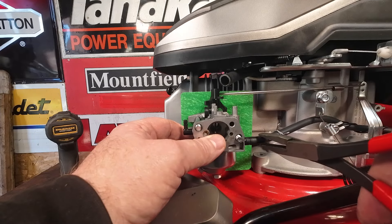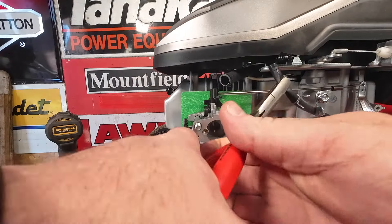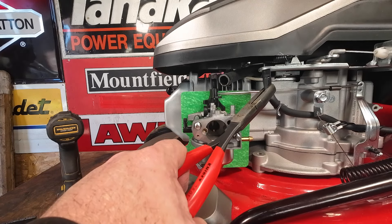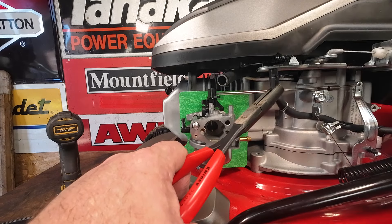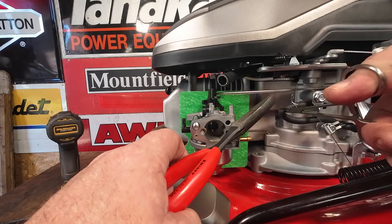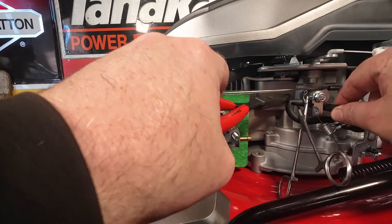I've got a pair of short nose stubby pliers. Once that clip's been removed, get hold of your fuel hose and give it a bit of a twist just to break the seal. You'll see it's starting to lick a bit of fuel. Hold it up in the air — I don't want to get petrol all over this lovely machine. Let me find a pair of forceps to clamp that fuel off.